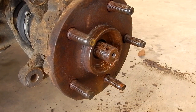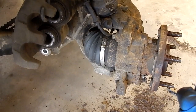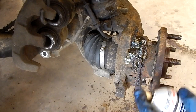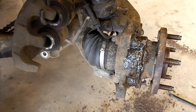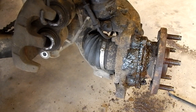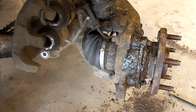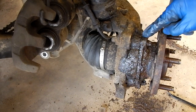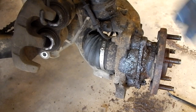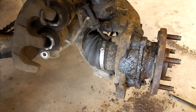At this point we're pretty much ready to take the hub off. So to do that we're going to put some PB Blaster around it and then there are three bolts in the back. I've moved the wheel again so you can get a little better view of our hub assembly that we're going to take off. This thing has 165,000 miles on it, it's over ten years old, and the hub assembly has never been off — so these are going to be a fun one to get off. There are three bolts; they're 13mm 12-point bolts, so you're going to need a 12-point socket instead of a six-point socket, and they are 13mm.